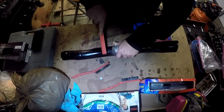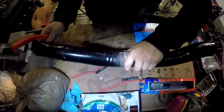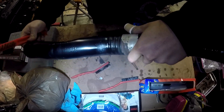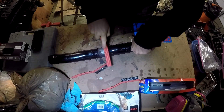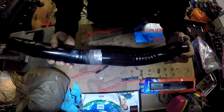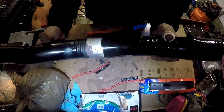Now moving on to the copper bristles. This is when we start getting through the paint — you're getting real deep scratches, you can see the primer, and that's no good. Water gets on there, it's going to get into the paint and slowly corrode. With little to no pressure I'm able to scratch right through that top coat to the primer. Over here on the POR side, you have to scratch for quite a minute to even do anything, and it's starting to lightly scuff but it still has that nice gloss look and nothing has gotten through.